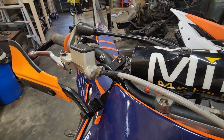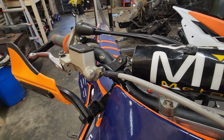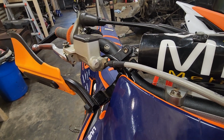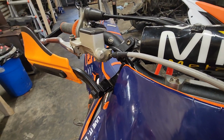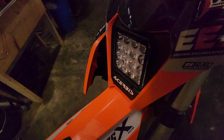The way that I turn it on and off is I break the ground instead of running through the hot wire. Because I've tried stuff like that in the past, and when you're running that amperage through those little wires on the hot, it always seems to get them really hot, and you can end up catching stuff on fire, burning through, whatever. It don't seem to do that with the ground. That's what I done. It works well for me. Just an idea for anybody else.